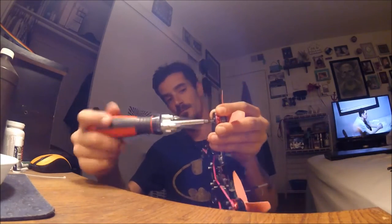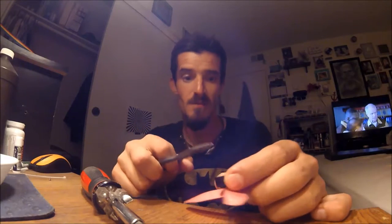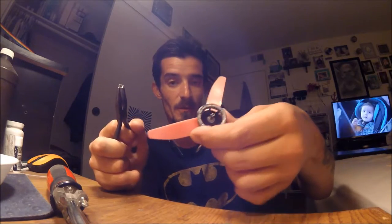I'm gonna take off the motor right now. Remember, you have a spacer here and a spacer inside the bell, so you've got to be careful and make sure you don't lose those. On the inside there's a little spacer, and when you take these off it's supposed to go on one direction only — it's not a flat spacer. See how it's got that little groove where it's rounded right there? That actually faces towards the top end of the bell.